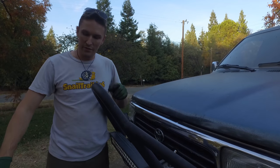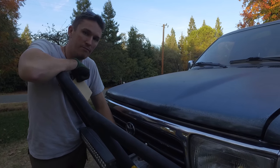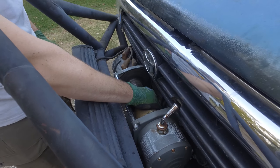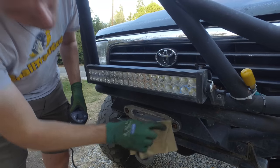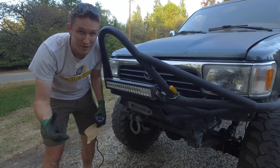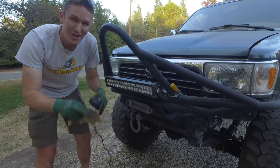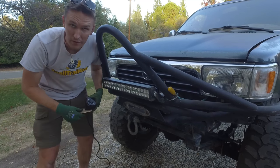Since we're going from a steel braided line to a synthetic line, the drum here is pretty rough and beat up, so we want to smooth this out. We're also going to smooth out our fairlead as much as possible. Grab a medium grit sandpaper and just hold it on the drum as we run the winch. Ultimately, you want to put a new fairlead on here when you swap from steel to synthetic — that's going to make your synthetic line last the longest. We're a little short on time, so we'll run a couple of trips and then swap it out for a new fairlead after the big Baja trip.